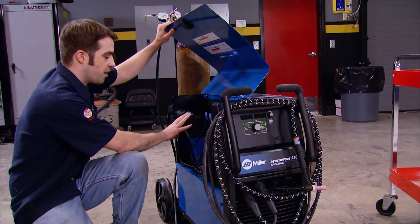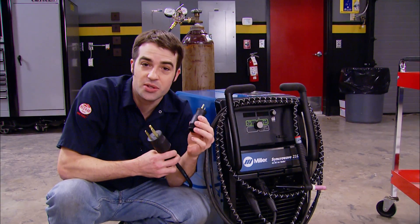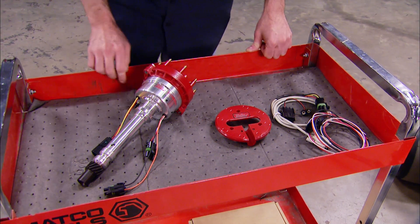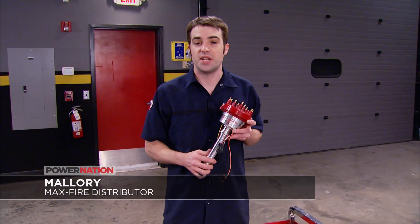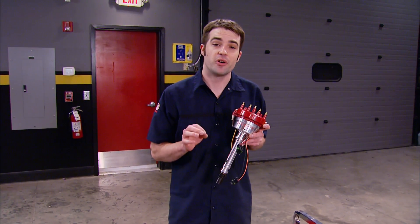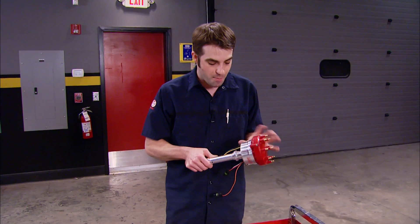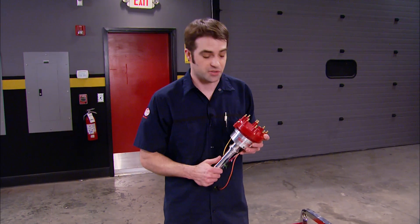On the side there's storage — a foot pedal and extra cables. It uses the MVP plug, which plugs into either household current or 220-volt shop current. Now, distributors have been around for ages, but they can be updated with modern technology — like this one from Mallory. The CNC billet Mallory Max Fire distributor has all the features of a modern digital CD ignition box built right in. It fires multiple sparks at lower engine RPM, has full electronic timing control with seven pre-programmed advance curves, and you can design your own using their software. It also has built-in rev limit functions and a map sensor that can handle up to 30 pounds of boost, retarding ignition timing proportional to boost levels.